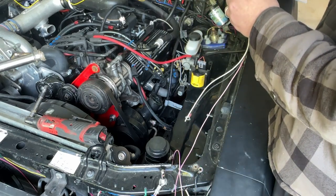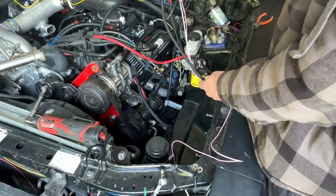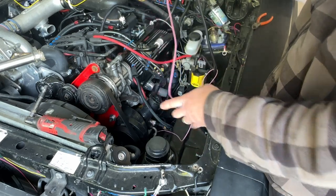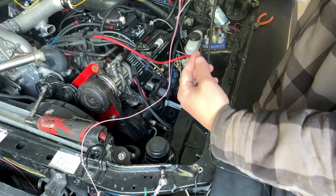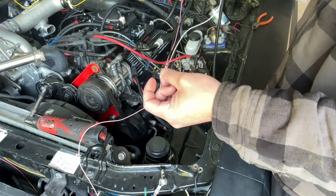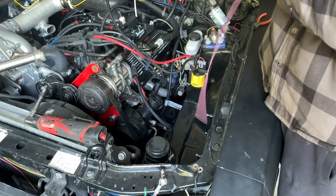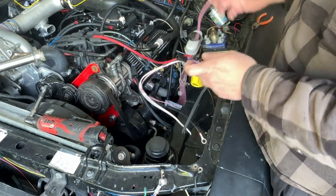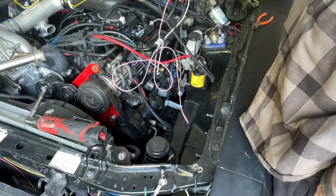I'm used to routing my car harness up the front of the motor with all wires going one way. The white wire goes to the white wire coming out of the Sniper harness. Pink is your key-on switched ignition power, and black is your ground — they don't give you much length for ground, though longer wire does increase resistance over time. I'll run this side of the harness up the passenger side of the motor to the coil, tuck the rest along the top of the intake valley, find a ground up there, and run the ignition harness back with the rest for a clean setup.